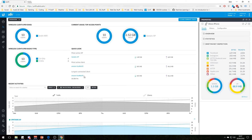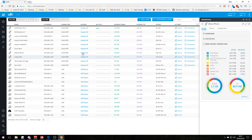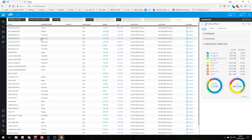Let me quickly show you the overview. On the map, you can list all your devices — if you have multiple areas or a big arena or house setup, that's pretty cool to do. Under clients, you can see all the clients on the network: Wi-Fi connections and LAN connections. The cloud key shows up here as a client, not in UniFi devices, because it's basically a computer running the UniFi software. Under insights, you can see neighboring access points — there's only one near the upstairs access point — and known clients. You can also quickly block clients if needed.